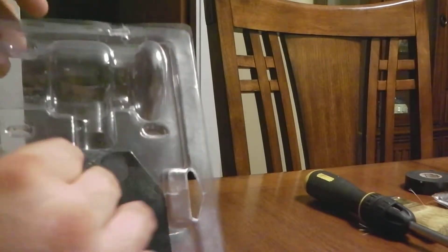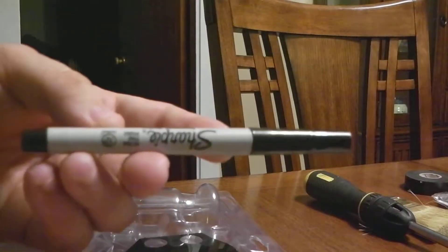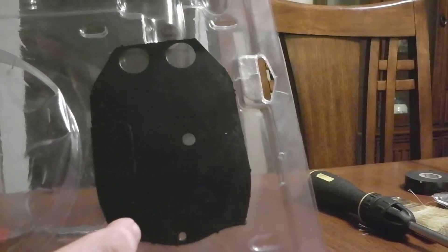What we're going to do is trace the outline of the bottom of the drone. I'll take the bottom plate off and trace it with a very fine Sharpie, then cut it out carefully to make a bottom plate. You also want to remember to trace the hole for the camera and the ultrasound emitters. I just finished tracing the ultrasound holes and the camera hole. It's clear plastic, so you don't need to make a hole for the middle section.